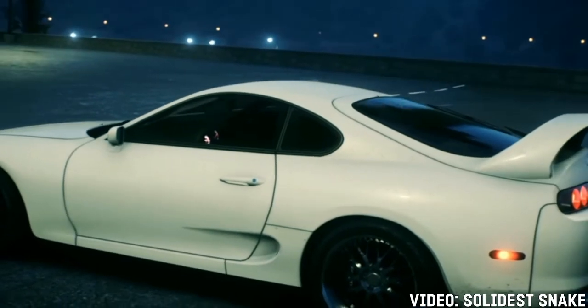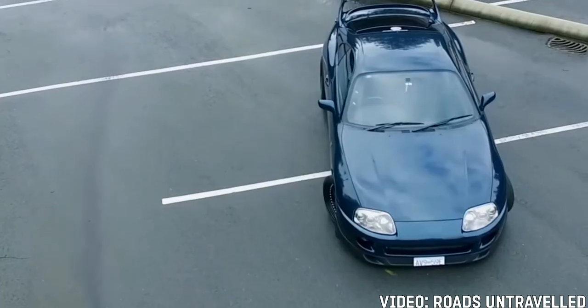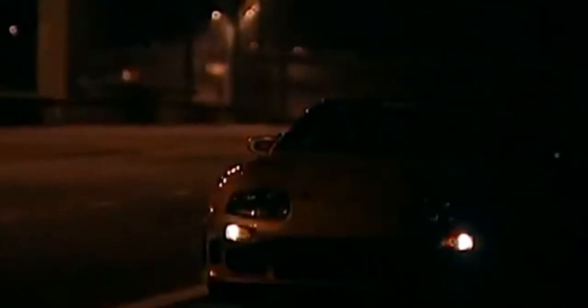Make sure all the exterior lights work. Check the headlamps for cracks, moisture or fogging, yellowing. Make sure to test every last switch in the car to make sure it works: power windows, locks, turn signals, light switch, dome lights, power seats, cruise control, etc.